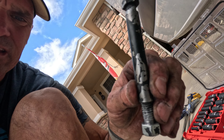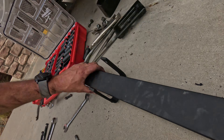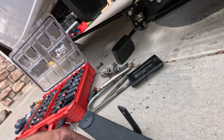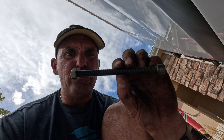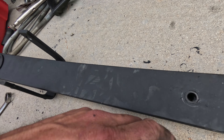These are 15 millimeter bolts and they come right out. This sleeve is just a roller sleeve to protect the bolt. I also took out the center pin. Now we're going to take the new long pin, insert it through here, lift the pack into place, and get everything aligned so it matches up right — hopefully with the clamps in the right spot so they're not in the way.